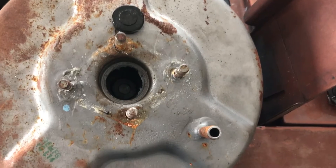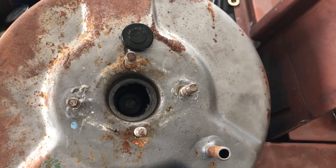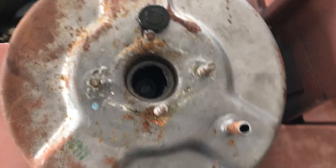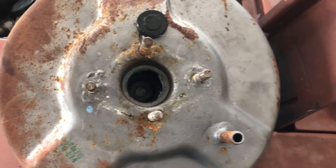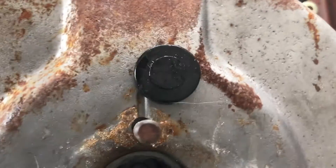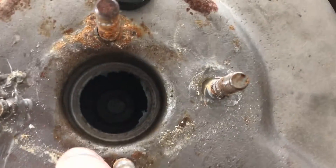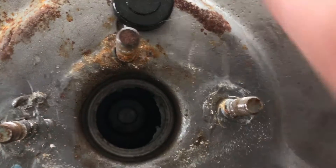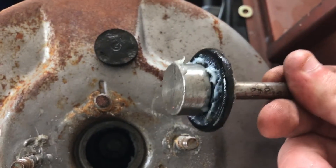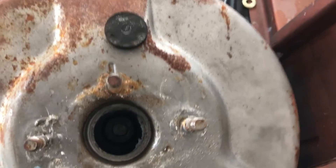Either way, it's a simple fix. There's just four screws or four bolts under the dash and then the bolts for the master cylinder. I would film it but it's a pain to get up under there — just crawl up under there, you'll see it. The biggest thing you want to do: make sure that gets put back, and you'll see there's two different sides. See how that's got the little circle piece on this side? That circle piece sets inside the indentation circle there, and then the flat side pushes against the flat side here. Make sure if you put it back in that you put it back in correctly.